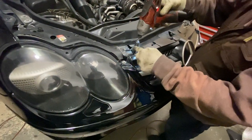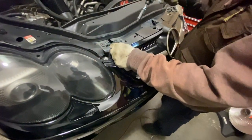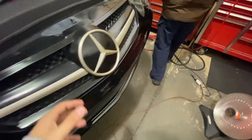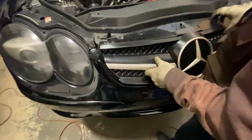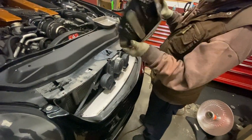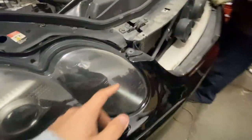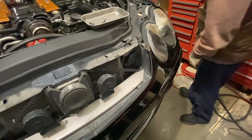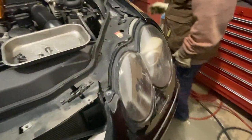To remove the front bumper, you have to first remove the grille. There are four screws holding the grille — undo all four of them at the top and push the grille in and it should come right out. After removing the grille, it's time to undo the two screws sitting on top of the bumper. Once you undo those, wiggle them and move on to the next step.